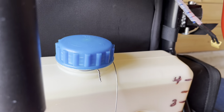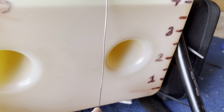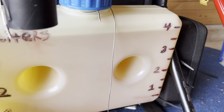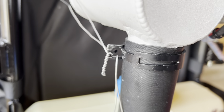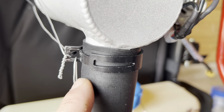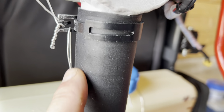I've got my tethers complete. The gas tank is tethered here, and I've also got another tether so that if it twists and comes unbolted, we've got it at different angles or different axes of rotation. With this style muffler, I wired it on to itself and to the clamp.